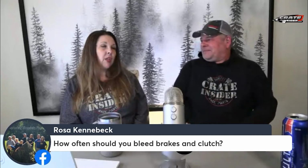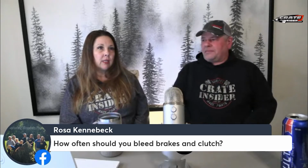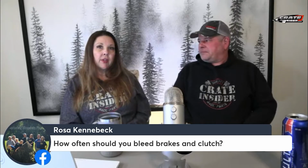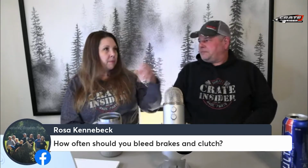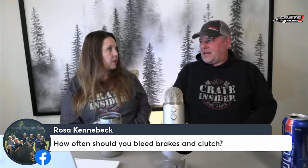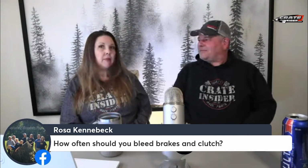Well, and with that, you definitely want to be using a racing brake fluid. Correct. That's why there's an AFCO brake fluid on my shelf very specifically, because it has a high boiling point that is meant for racing brakes. And it's also meant to tolerate water contamination. Correct, it's meant to be able to do that.